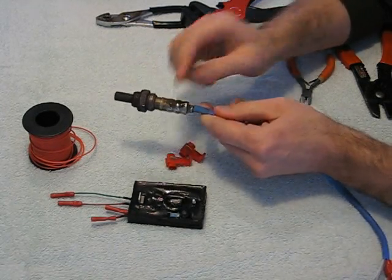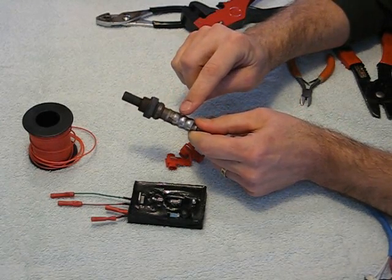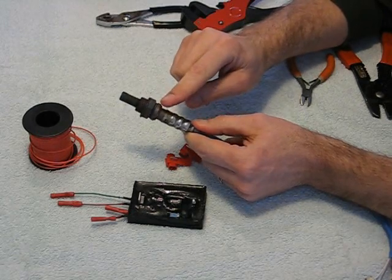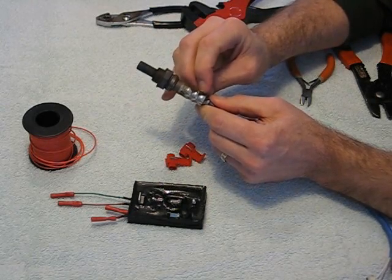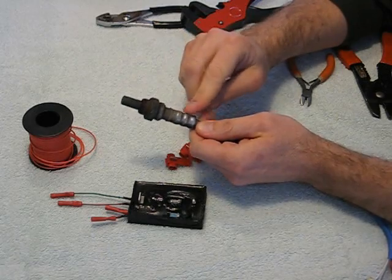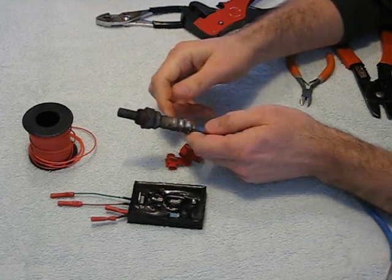After you've found them, you want to inspect the outside of it. This one does still work. However, the outside of it is very dirty. The outside of the O2 sensor does react with oxygen, so it's very important that the outside of the sensor stays very clean. If your sensor is dirty, you can clean the outside with some isopropyl alcohol and a clean cloth. Make sure you don't get any fingerprints or oil on this — just don't touch the outside of the sensor. And if you do, make sure you clean it off very well.